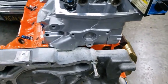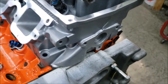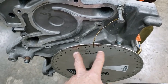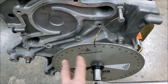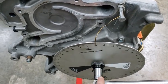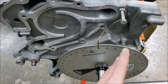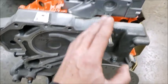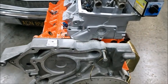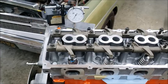The valve is right there — the piston will chase the exhaust valve closed, and then the intake valve chases the piston down. Remember, you're going to have about 20 degrees — maybe 22 degrees depending on your rod-to-stroke ratio — where the crank is rotating but there's no piston movement, because the rod has to go from one side to the other. That's 20 degrees of cam movement, especially with fast cams running something like a 1.65 rocker arm ratio.